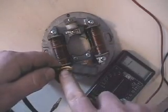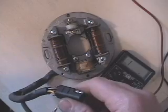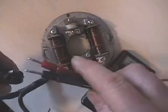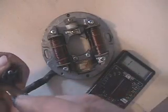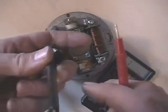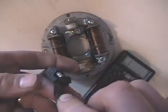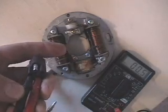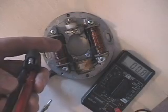The four-prong has got the two yellow wires in it, and we can go ahead and check those wires for continuity. Those two yellow wires are for power from our coils. With continuity checks, all you're looking for is to make sure the wire isn't broken, so your ohms are going to be very low — 0.4, 0.5, or 0.6. It doesn't matter if you use positive or negative leads; put those in the two female positions. You can see on the multimeter 0.5 or 0.6, so we know there's continuity and that wire isn't broken.